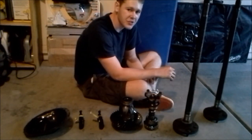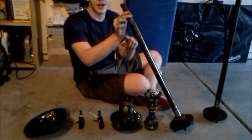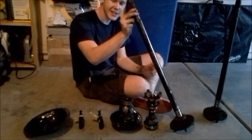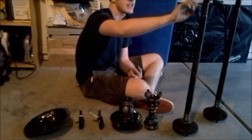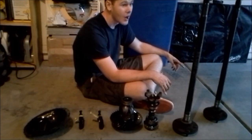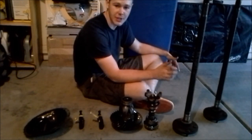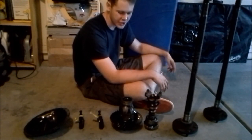We already talked about our axle shafts earlier, but I'll add a couple of things. Make sure you really don't hit these splines on anything — if you mess up your axle shaft splines, you're probably going to need a new axle shaft. Make sure you keep track of your C-clips; they're really small and they like to hide. If you need to replace your wheel studs, now's the time — if you broke one, you can just hit it out with a hammer, press in a new one, and you're good to go.